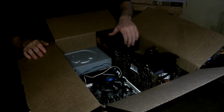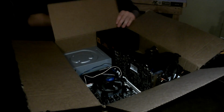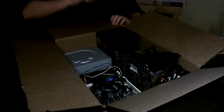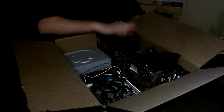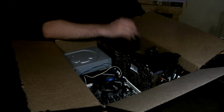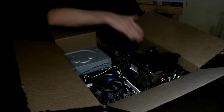But the other thing to keep in mind is this power supply outputs here. So it looks like we're going to have to cut some holes on this side of the box back here because the power supply pushes air in here and then pulls it out here. If you don't do this, then it's really dangerous because your power supply can get in a bad situation. So you've got one input fan here. This actually pushes some air out here as well.